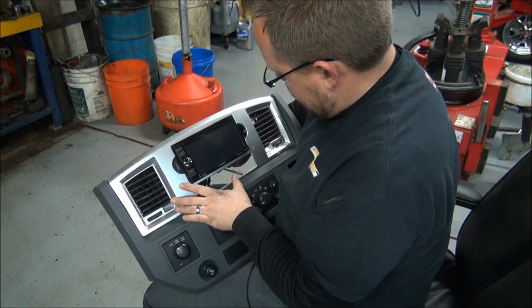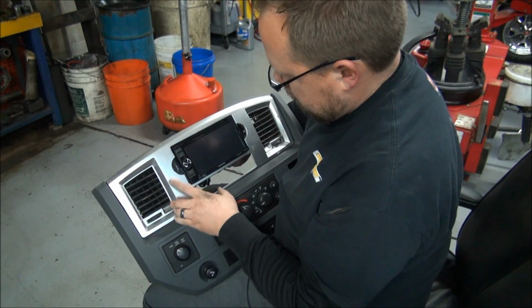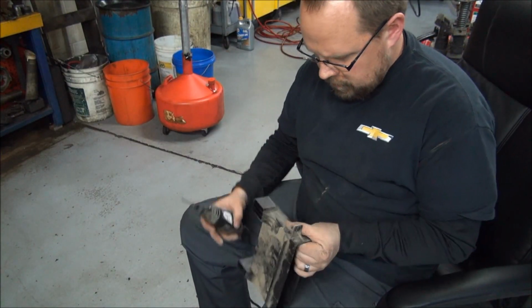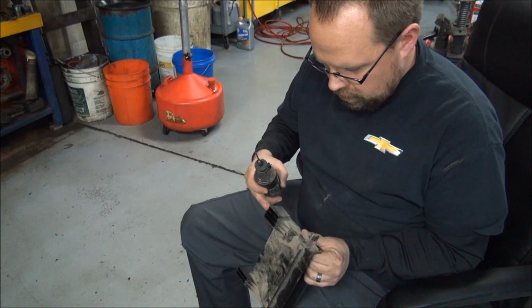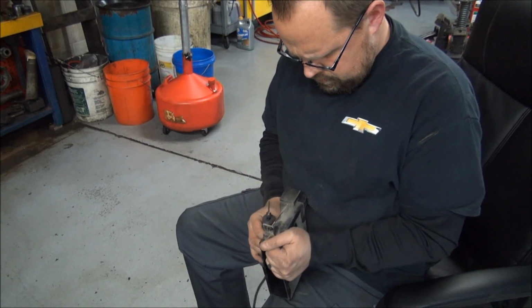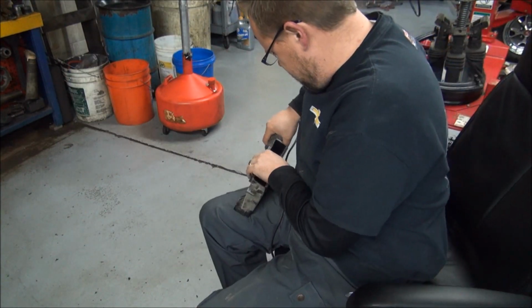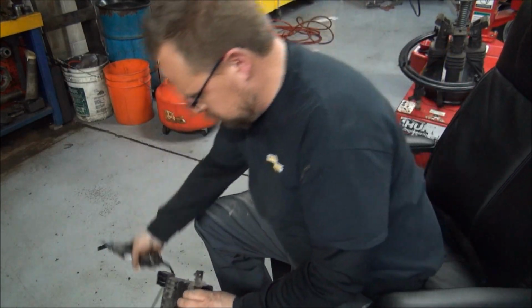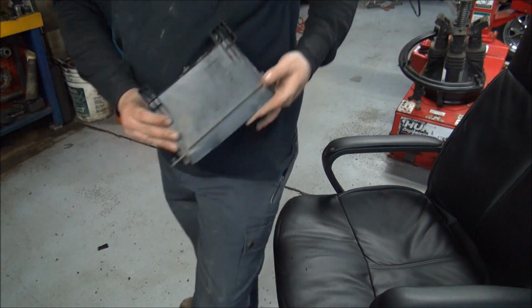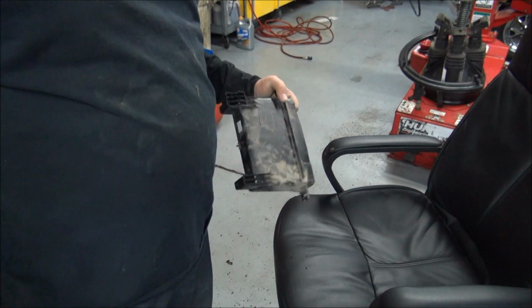And then we're going to use those side pieces that come with our other dash kit so we can fill in those little half rounds there. Alright, so now I've got the pocket out of there. These risers were to secure the old factory radio, but they're up too high. We got to cut those off. Probably going to put these babies on the bench grinder. It's not too important to make it pretty because it's just hidden behind the dash, nobody sees.